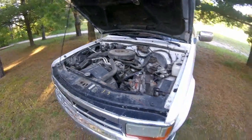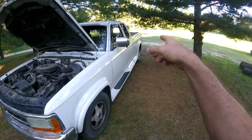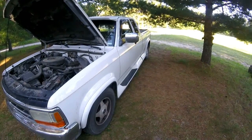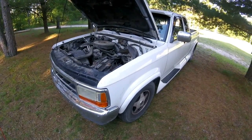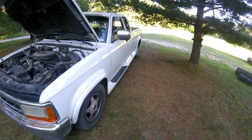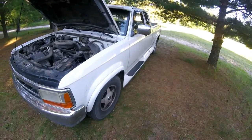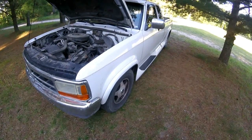Now, the other day we went to start the truck. It won't run. The gas cap is not locked. I can't do a thing about that, alright? It is how it is. And they must have done something, because now the truck won't run. It's not getting gas up into the carburetor. I don't know if somebody put something in the tank, or if by chance the fuel pump quit. I'm not sure yet. Alright, so I'm not going to make any accusations on that. But the truck's dead, and we are stranded here with no transportation at all.